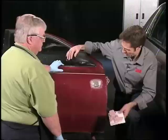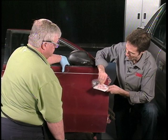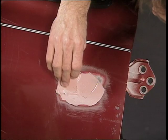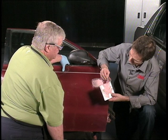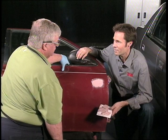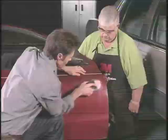All right, so you've sanded it, you've wiped it down, and now it's a matter of applying the filler. And as we both know, it's got to be really mixed uniformly. Now, any particular tip when applying it? The first coat wants to be a good wet coat, tight coat — make sure you get it pressed in good. When you're saying a wet finish, it's where you're making good contact all the way around, making good contact to the metal. This is basically all part of the kit too. Make sure you put enough filler in the middle so when you sand the edges, it brings it down even. And the smoother you wipe it, the less sanding you have to do in the end — you see a lot of people overfill something and spend the rest of their life sanding it back down. How long do we need to wait for that to dry? Approximately 20 minutes. And we'll come back and re-sand with 80-grit sandpaper. Coffee break.